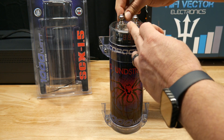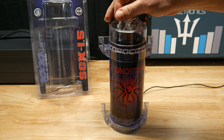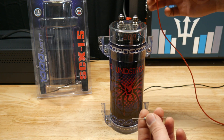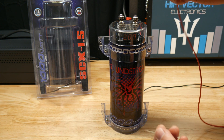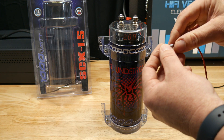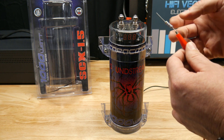The purpose of the resistor: you hook up your positive and negative first. Sometimes they make the positive and negative markings very small and hard to see, so make sure you get that right, because if you hook it up backwards, a lot of times that will damage the cap instantly. So we got the ground hooked up and the 12 volt. We don't want to just connect that because it'll act like a short — the power will instantly arc in. The resistor goes in between and creates a buffer, slowing down the current so you don't get that short circuit effect. You can put it in line on the negative or in line on the positive.